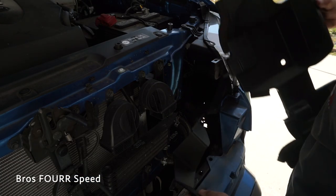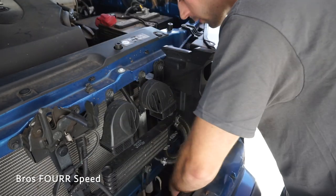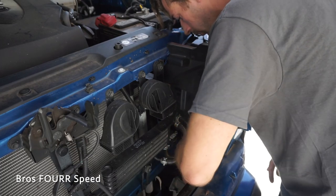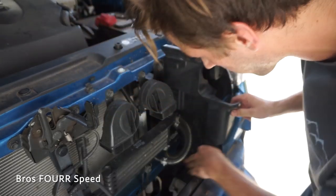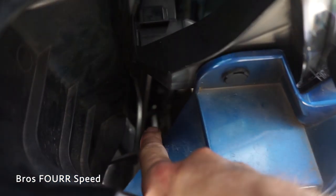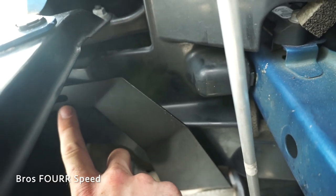On to the driver's side — this is where you need two hands to do it. I'm going to lay this bracket flat on the crash bar. It's pretty flexible so you have a little bit of wiggle room. Half of the bracket is on one side, the other half is in my hand, and now I can look at where I need to line it up. Once I get it lined up, I can put this back together. This part of the bracket is flat up underneath this piece and flat against the crash bar. Way down in there are the two bolts on the back side of the crash bar, so effectively that bracket is now in place with the hole lined up for the light bar itself.